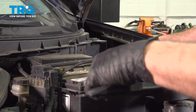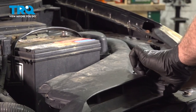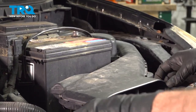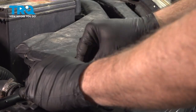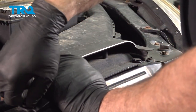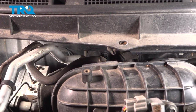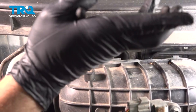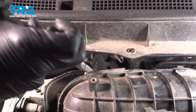Go ahead and install our air intake tube into the air box. Connect the other intake port down below and snap that in. Then go ahead and install our plastic push pins across the front here. On the backside of the intake right here, there's a clamp with a hose — use our pliers, slide that clamp down, and slide that hose off. Just pull this off to the side.